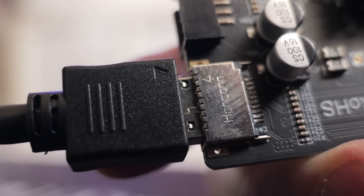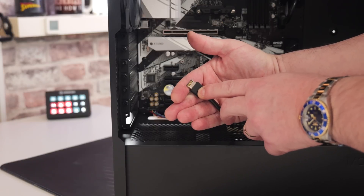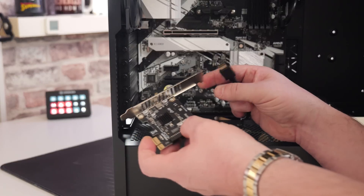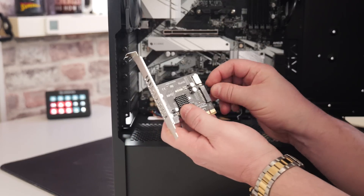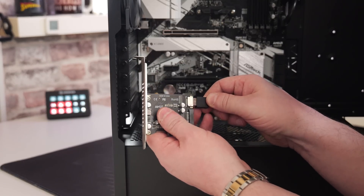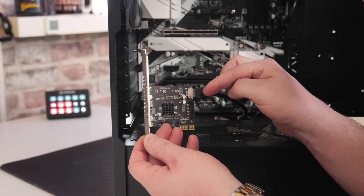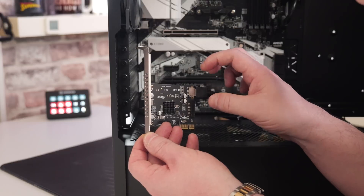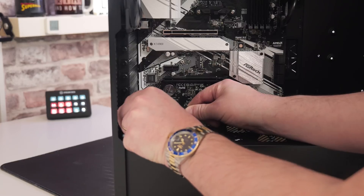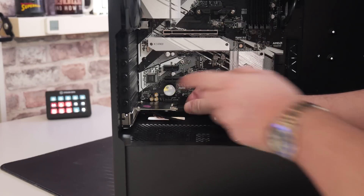Pin 1 is down here, and on our cable there should be a small triangle on the far side — those have to match up when we plug them in. You can actually take your PCI Express card and plug the cable in first of all. Take note of the notch on both sides and just plug it in — it should click into place. If it doesn't want to go in, don't force it because you'll damage it; you might need to turn the cable around 180 degrees. Now line it up with the PCI Express slot at the bottom of the board and the slot at the back, and with just a little bit of pressure it should lock into place.